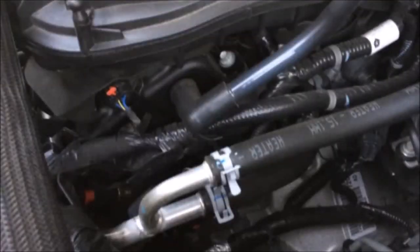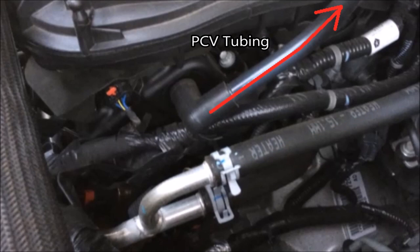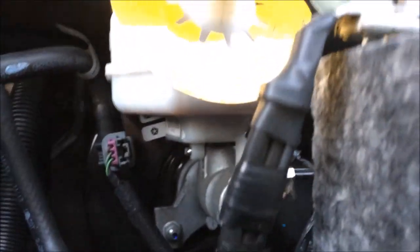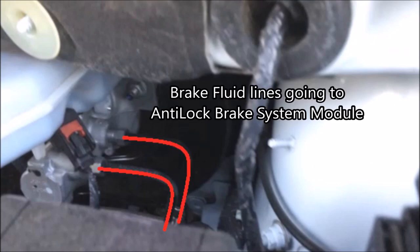Those are theoretically cooler lines returning to the water pump. Here's part of that PCV tubing extending across the air intake manifold, going back to the air filter box — ideally just carrying moist air. There's the radiator line T-junction, some of the AC unit protruding out of the firewall, and then the brake master cylinder with two lines heading down to the anti-lock brake system, which will split into four for your four brake lines.